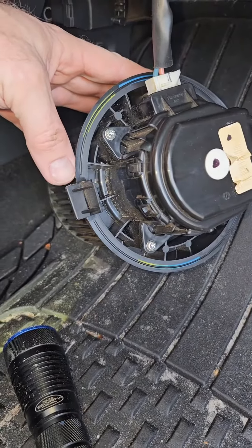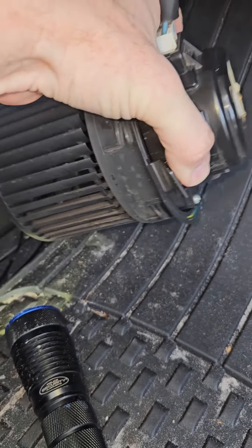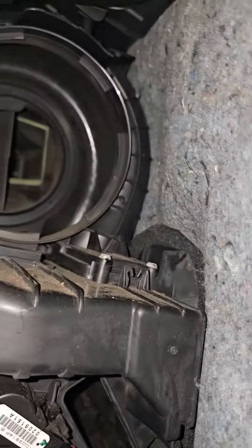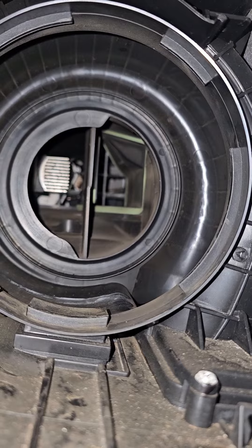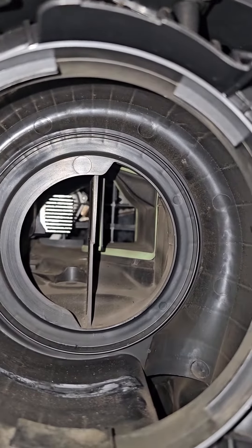You can see I still have the wires hooked up. I'm just going to turn the blower on and make sure it performs. Here's the little plastic clip I was talking about — just push down and twist and it'll come right out. I'm going to stick the shop vac up in the hole to see if there's any debris in there because it's not blowing that well.